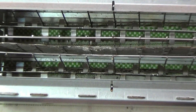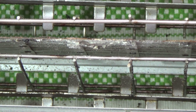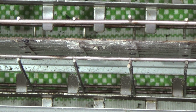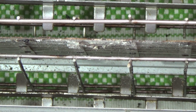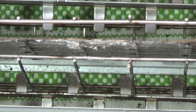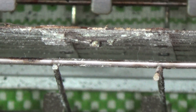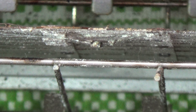One of the things that's really hard to repair is nichrome wire. The wire that runs across the toaster that heats up when you put electricity on it is made out of nichrome, and when they break, it's hard to put it back together. I've tried once — kind of a failed experiment — and what I'm going to do is clean that connection up and then try to put a patch on there made out of still more nichrome wire and borax to act as a flux.